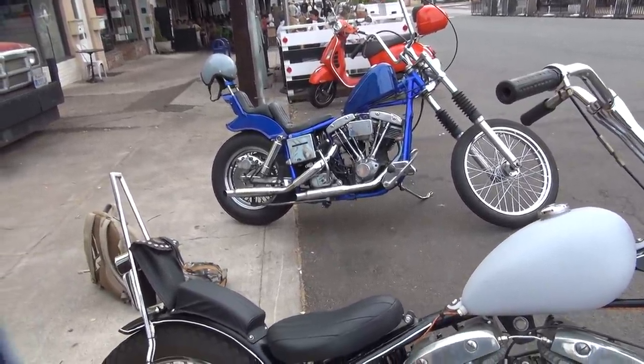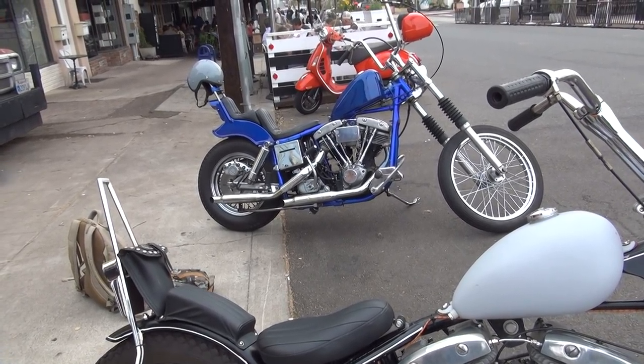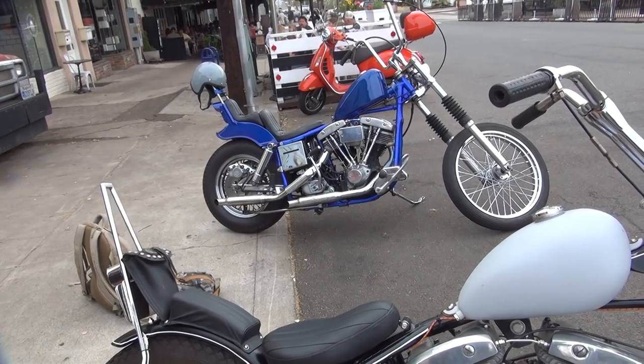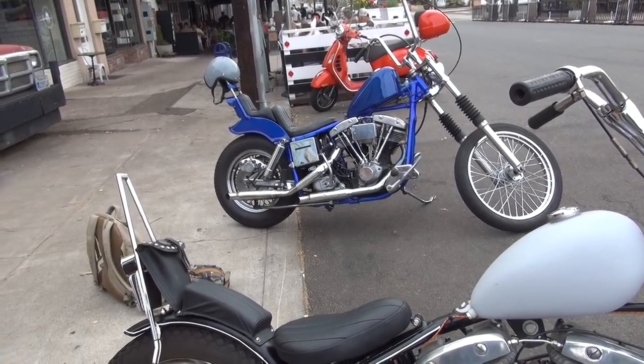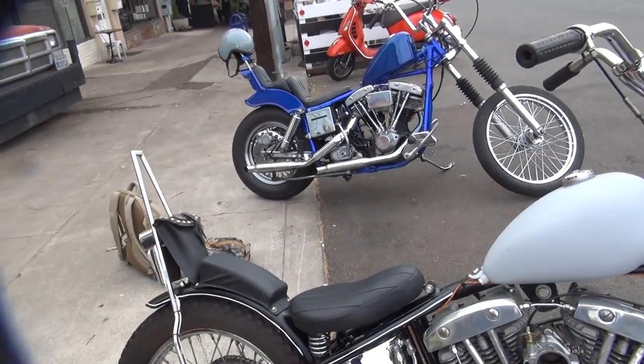So when you put the bigger low speed jet in, did it get better or worse? I think it did. I need to put it back in. I was trying to test it too. I don't have an accelerator pump on either. It's all the way turned off. Turn it on a little bit. I can't. Some idiot ground the rod too much. We made a new rod. I know. I got to put it in there.